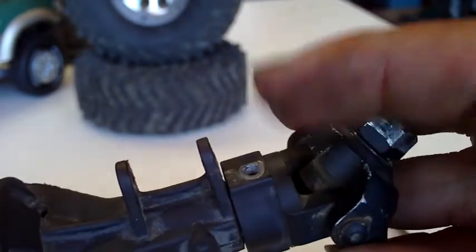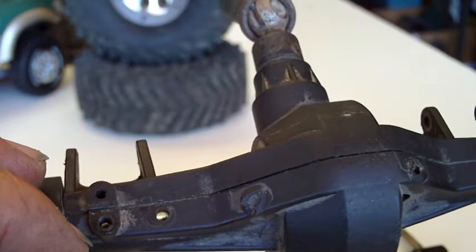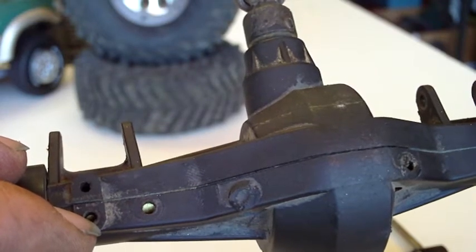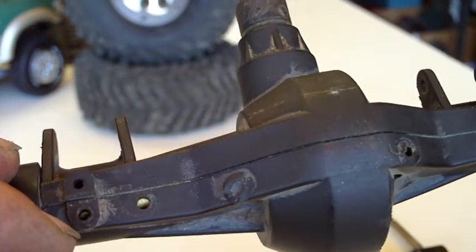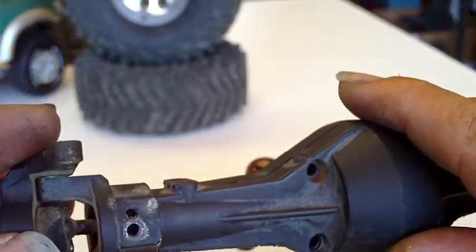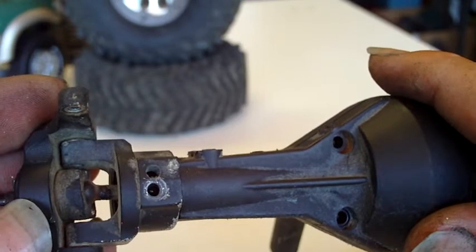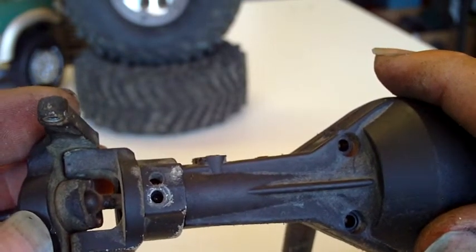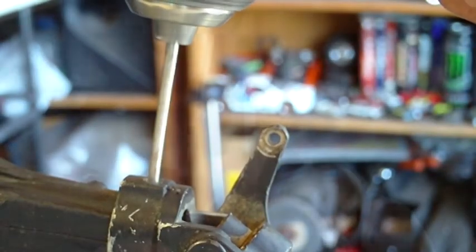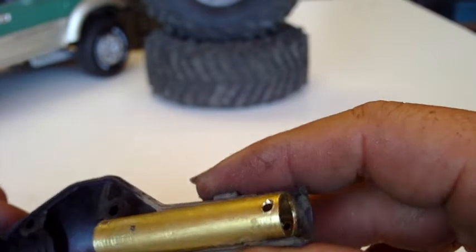On our project here, we've got a couple of holes to mount the C-hubs, and as I mentioned I've got a slightly different panhard mount on this vehicle, so we're going to drill and clearance those holes and tap them — just to make sure screws don't hit anything and we don't bottom out. We're going to get this chucked up in the vise, get some holes drilled, tap them, put some hardware back on, put some fresh grease inside the axle, and we should be good to go. The tubes are all drilled and tapped.